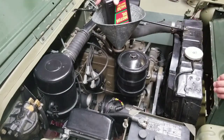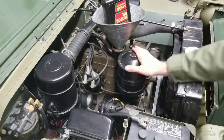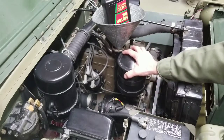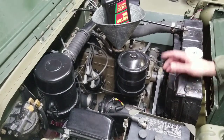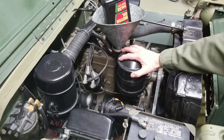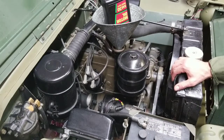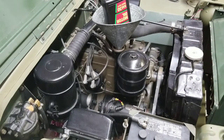So I'm going to go ahead and put a few of these quarts in and finish up the job. Very easy to get to oil filter — you don't need an oil filter wrench, you don't have to crawl under the car to find your oil filter. It's right here on top, very accessible. Drain it, change the oil filter, put the plugs back in, get the filter element housing all tightened back up, add your oil and you're done. Pretty easy. See you guys next time.